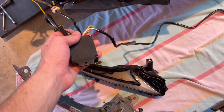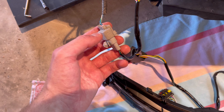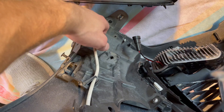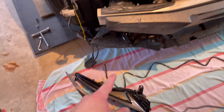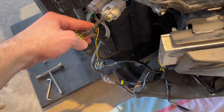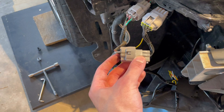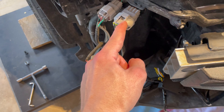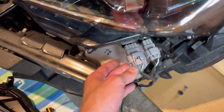You need to tap into a plug that's only on the left side, and this wire is pretty short. To test, you're going to take the gray connector coming from the module and plug it into the original power for your daytime running lights — that's what would have plugged in down here. Then you tap into your headlights on either side to get the turn signal function. There's a double gray connector coming out of the yellow connector — you unplug the original headlight connector and plug-and-play.